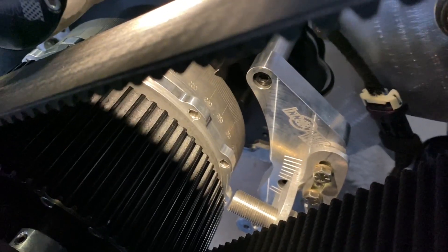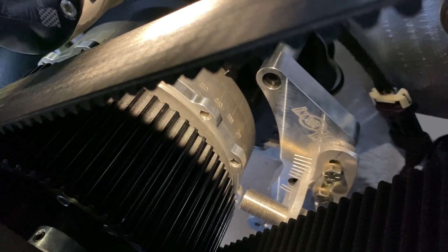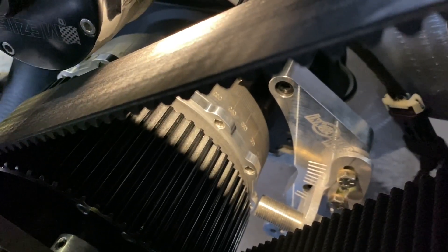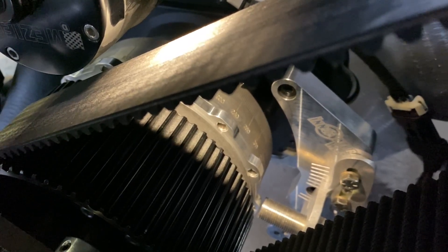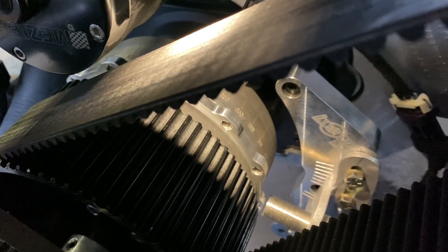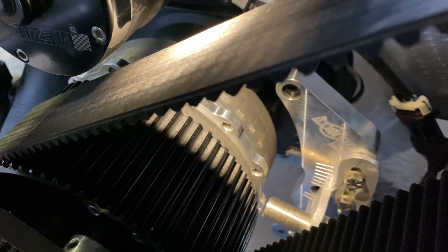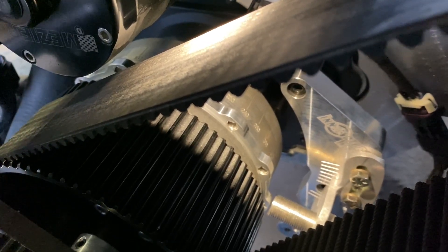Now with this being a 12-magnet setup — I don't even know why they make it with 12 magnets. On EFI, if you've got 12 evenly spaced magnets the computer is not going to know where it's at. You always need some type of gap, something different so it knows where top dead center is. I just got a 58-minus-two wheel on mine — you always have to have some type of missing tooth.